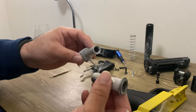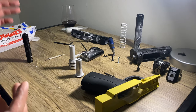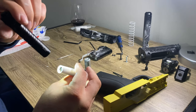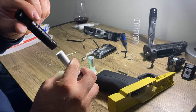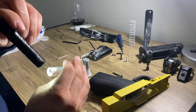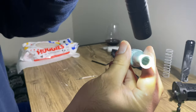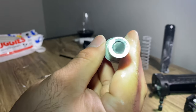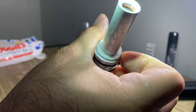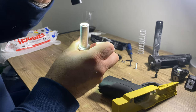I have to check the O-ring, so I'm gonna get a flashlight and take a look at it. Checking the O-ring now to make sure it's not damaged — it looks good, it doesn't look broken. That's the O-ring right there. I'm gonna clean the bolt, grease it up, and also put some oil on the O-ring.